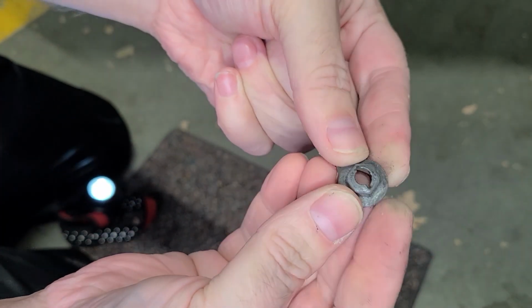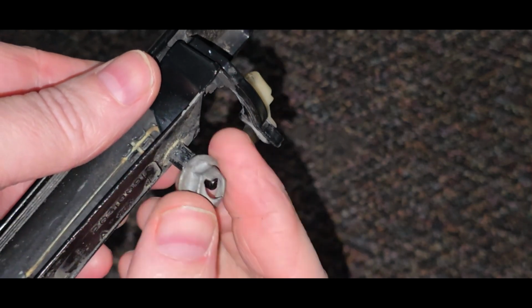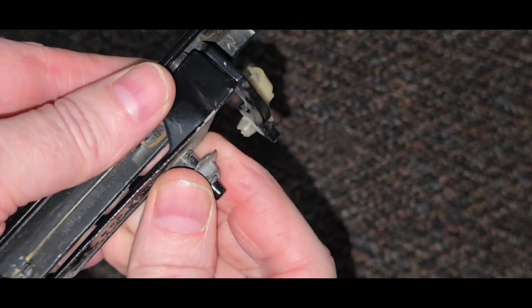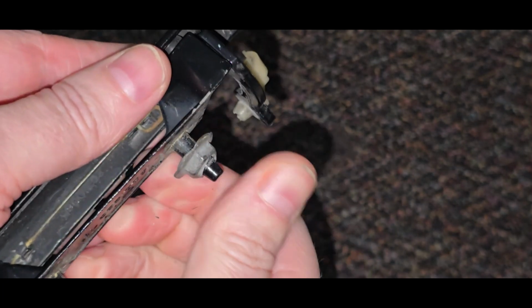It's not actually a threaded nut. Rather, they're a thin, heat-treated spring sheet clip that acts similar to self-tapping screws, but in this case, it creates grooves on the plastic studs. Now, the problem with this is that it leads to loose door handles, since once the speed nut loosens, well, you can't just simply screw them on tighter because there's no actual threads.